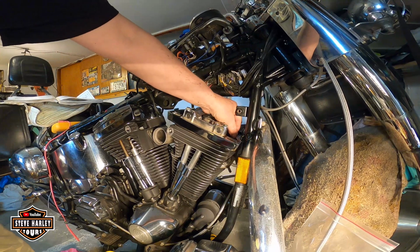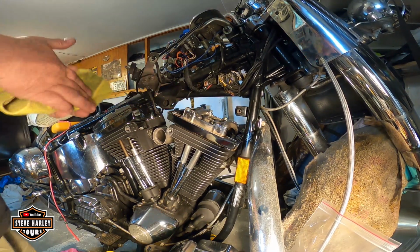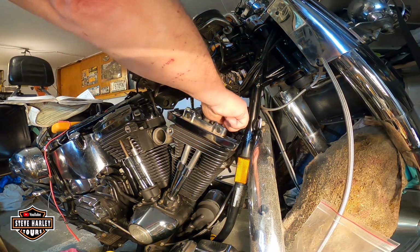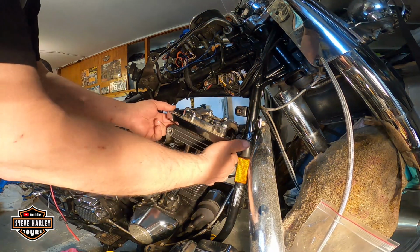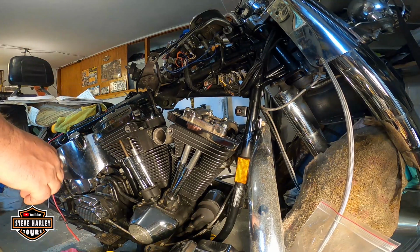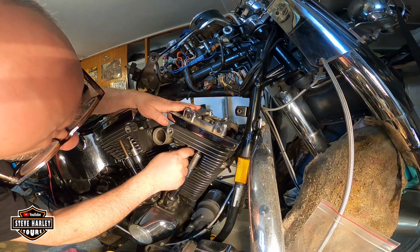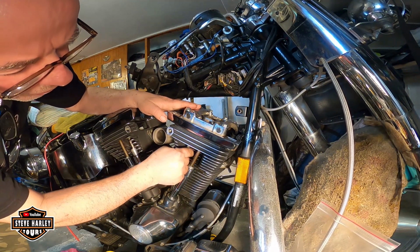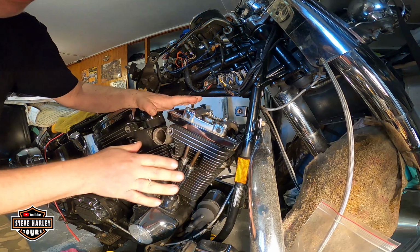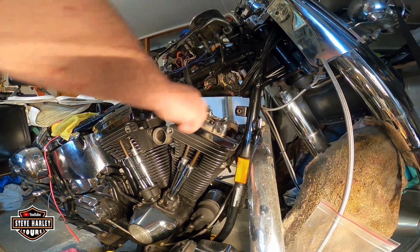Okay, this one's a little bit difficult here, but all right. There are more of this one. Okay, the gasket is in position. We're all good here. Now take this down so you can inspect the push rods. You see, this one you can't even move anymore. This one is already hard, and I haven't applied any pressure at all yet. Okay. So that's why we have to take our time with this.